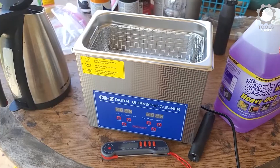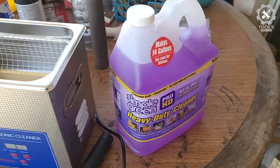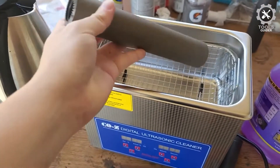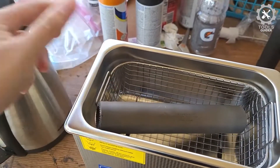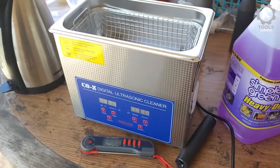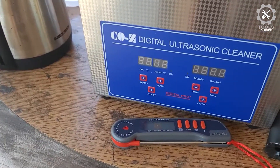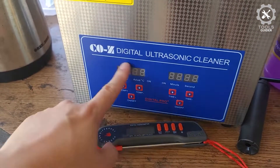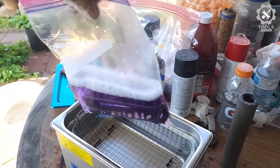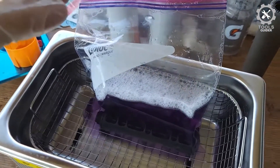With the help of high quality industrial transducers, it provides a 40 kHz frequency to ensure better cleaning. It comes with a maximum of 80W ultrasonic power and around 200W heating power. You can pick your preferred cleaning time from 1 minute to 30 minutes, and the temperature is also changeable. It has rubber feet, embedded handles, a cooling fan, and moisture-proof PCB. The package also includes a pair of chemical-resistant gloves.